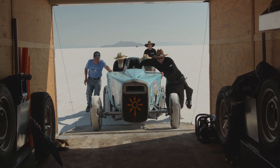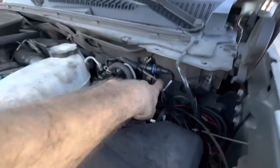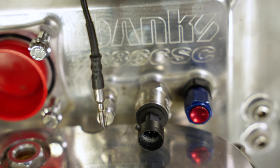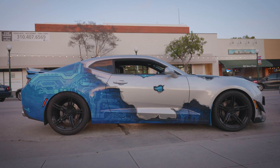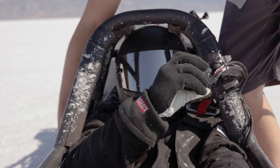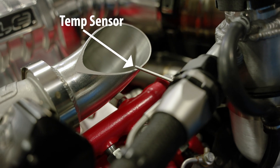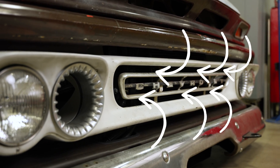With just pressure, temperature, and frequency, there's a massive amount of data you can gather from your own vehicle. These pressure sensors can be used in air or liquid, so you can use them for things like manifold air pressure, engine oil pressure, or even monitor air pressure in your air suspension. With temperature sensors, you can get vital readings from your trans or diff, or use them in open environments like we did on Lockjaw to get blow-off valve temps or even fan in and out temps.